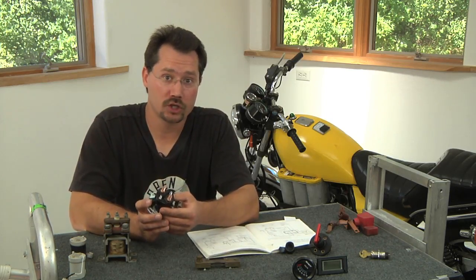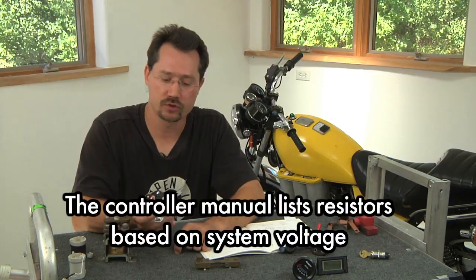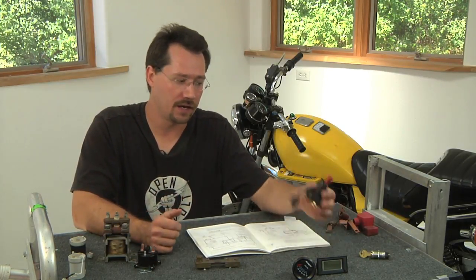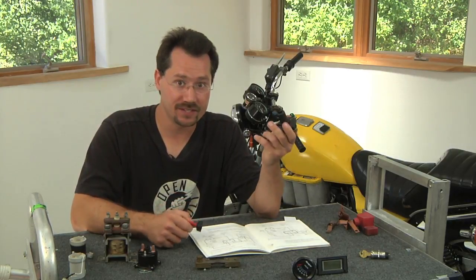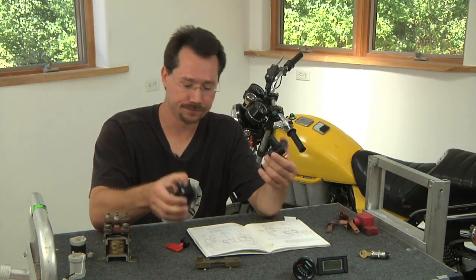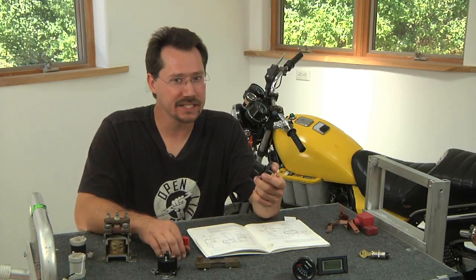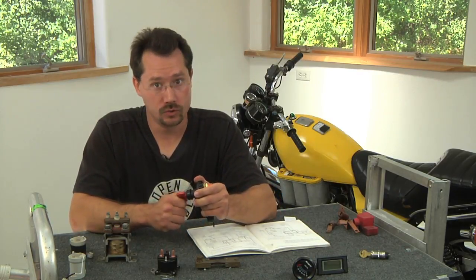You want to make sure to have that pre-charge resistor in there — basically with a pair of ring terminals bypassing or shorting across those two main power terminals. That also means you pretty much always have power going through your system, and that's one of the reasons for that battery disconnect — it's a way to completely disconnect power from your system. Keep in mind that even if you have the battery disconnect pulled out, there's still power in the capacitors in the controller itself. There's still a little tiny bit of juice in there that does dissipate over time, but anytime you're working on the cycle you need to keep that in mind.